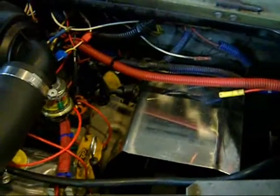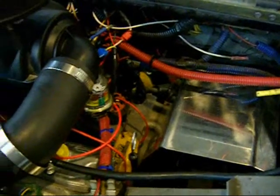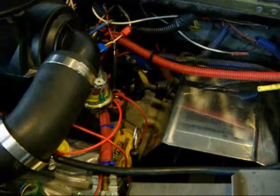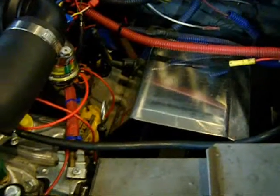If you look at this — Rock Doctor, Grizzly Adams, whatever you want to be called nowadays, all my sarcastic names — let me know what you think about that secondary clutch, if it's supposed to be idling around like that in circles, or should my belt be a little bit larger. Also, I got a little flat spot on this governor — when my linkage pulls here, the governor on the throttle body kicks in a little bit later, so I don't know if there's something I can play around with to smooth that out. That's where I'm at right now.